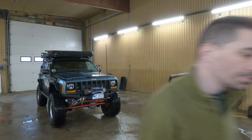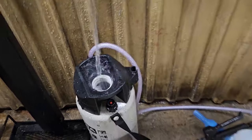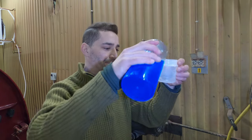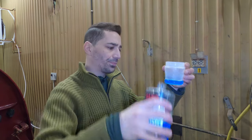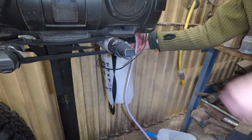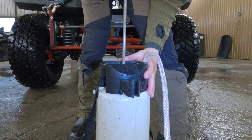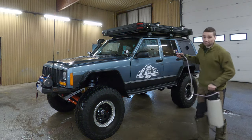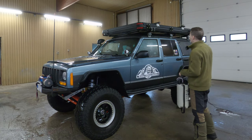So anyway, do the wax. If you're using the same sprayer, just make sure you clean it out first. Now all we're putting in of this Aqua Glide is 15 milliliters into the measuring cup — don't overcook it with this, because if it dries too quickly you're going to get marks all over the vehicle and they're difficult to buff out. That's with one litre of water. Now pump that up and I'm pretty sure you spray this stuff top to bottom, unlike the other one, but I haven't really found it makes a difference.